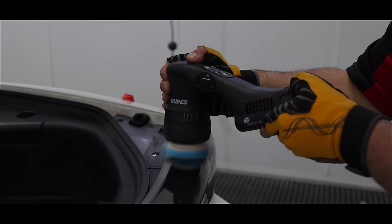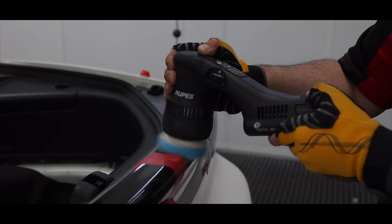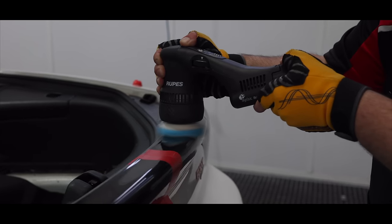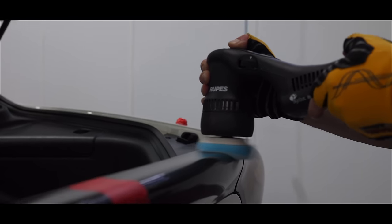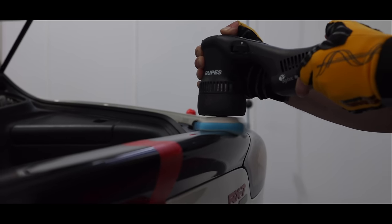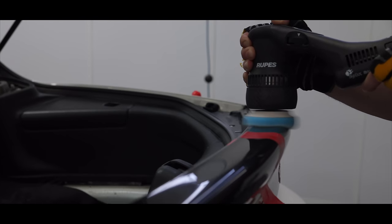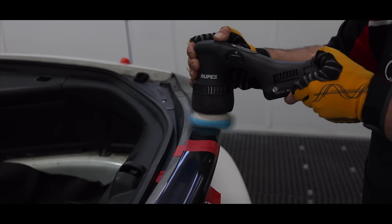Some of the worst defects and weathered finishes were on many of the clear plastic lights and reflectors that were in desperate need of a little correction work. And just like the white paint, they too had thin clear coats that in some areas were beginning to fade and fail. So I used the very same light combination and technique to remove oxidation, staining and haze, and restore the gloss and saturation back into their finishes.